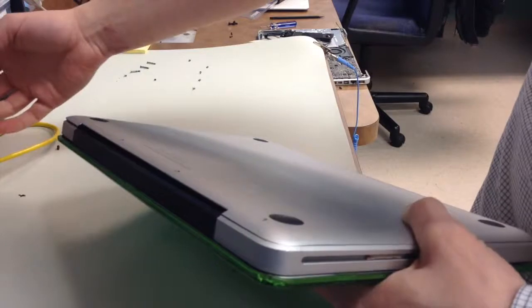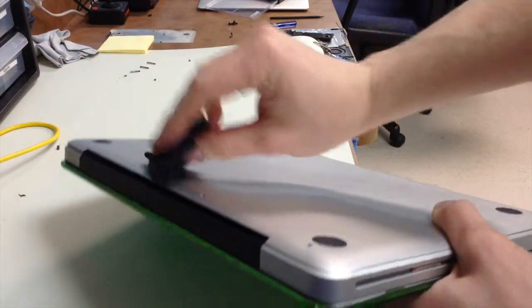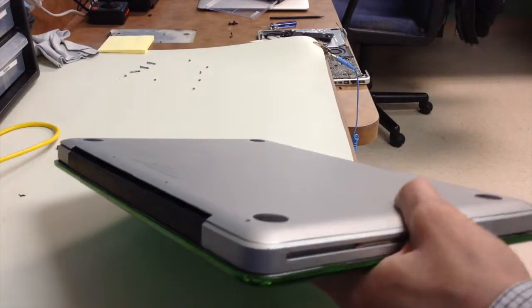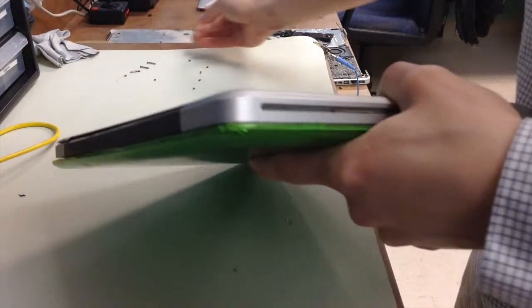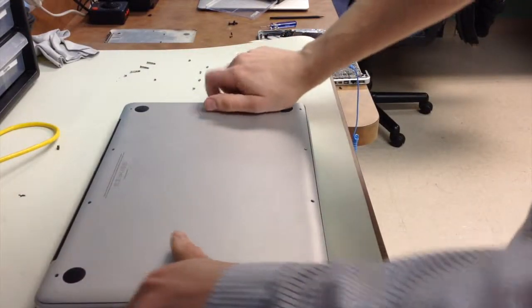So it's important to make sure that you're using your computer on a hard surface. If you're somewhere soft, like on a bed, and I take this cloth here and I cover it up, it kind of completely covers the gap, makes it hard for heat to circulate, as opposed to if you're on a flat surface, that allows the gap a little bit of room to let the hot air come out. So something to keep in mind if you notice that your computer runs a little bit hot.